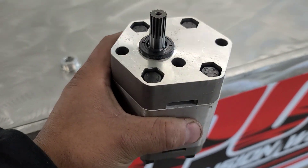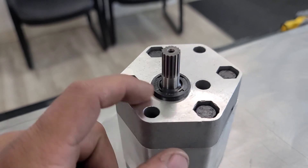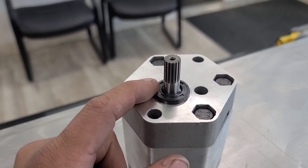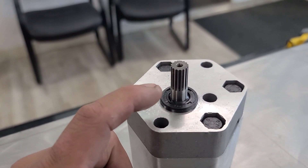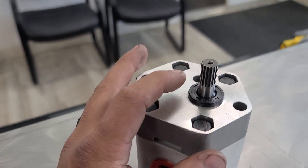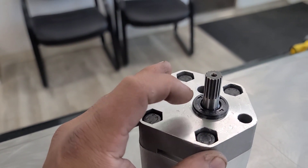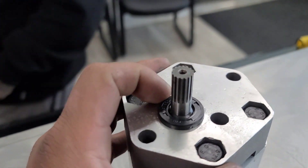For those of you guys that don't know what a super seal is, we're going to run through this real quick. This is the main shaft seal right here, and this is going to pretty much hold all the oil back from your motor. So if you guys ever have the issue with oil leaking into the motor or into the casing, this right here is going to be the only way oil could get into the motor. A lot of people always ask if oil on their motor is coming from their dump — no, the dump has nothing to do with it. The only way oil could get into the motor is through this seal right here. This is what comes standard on all the gears.